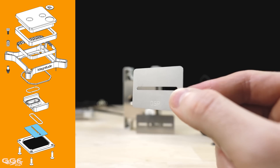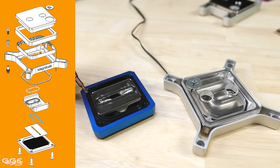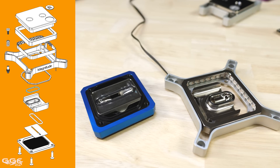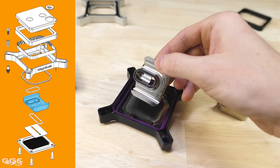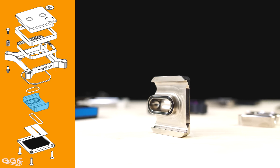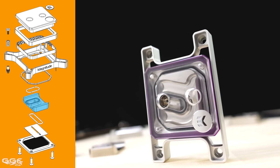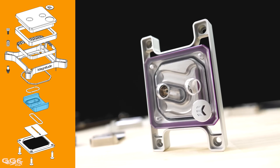Only 0.5mm thickness jet plates should be used with the flat cold plate. There is a jet plate O-ring, and together with the inlet O-ring, it ensures all coolant passing through the block is directed under the jet plate and through the fin array. At the centre is the insert, quite different from what we're used to seeing. On all Magnitude models, this is made from solid brass and is essential to apply pressure to the cold plate and IHS correctly. AM4 versions receive an asymmetrical design, allowing the dies to be directly targeted with peak coolant velocity.